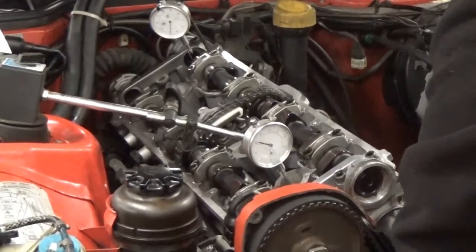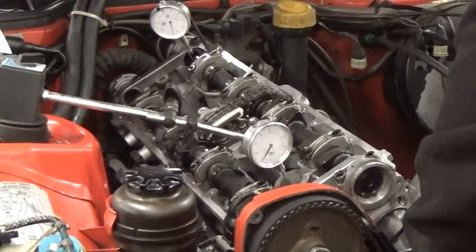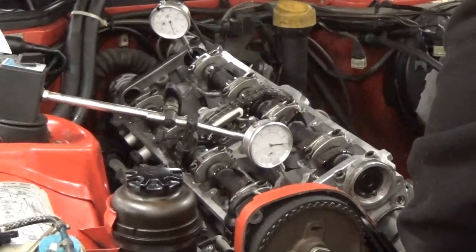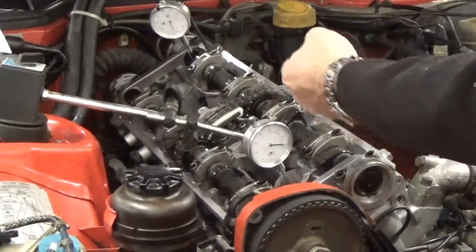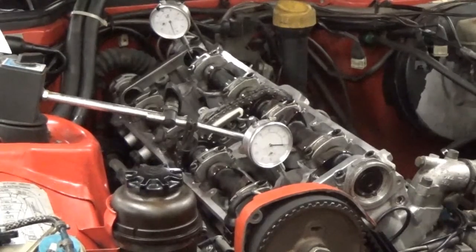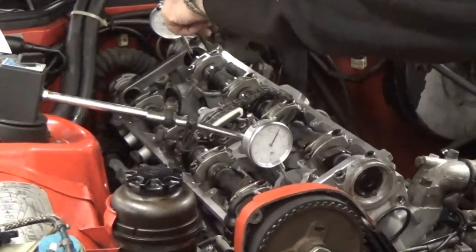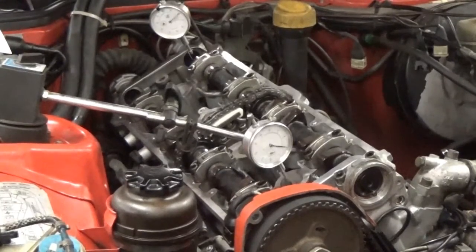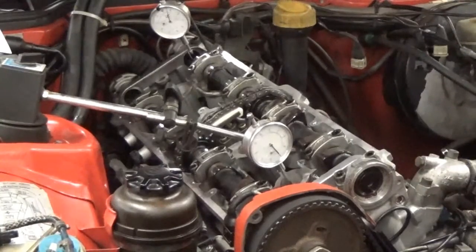As I turn this a little bit, we can now see the needle in the back on the intake valve just starting to move, and we can also see the piston at top dead center starting to climb up. This needle is going to make one more revolution, and when it comes around, pauses, and then starts to go the other way, that pause is where top dead center is. That pause is going to happen right at about 56 thousandths, which is about the top of that gauge — right about here is top dead center and that's our 56 thousandths lift. Now this needle is going to start swinging back the other way.